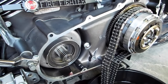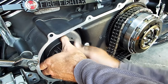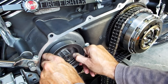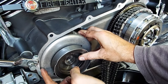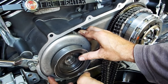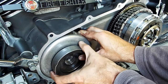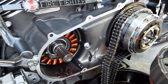Up to about here is how little aluminum had to be taken away for this to fit out through here. The magnets are going to pull and work against you of course, but if you take your time — there it goes. Through trial and error, when I got it this far off the bike and it would bind, I could see in the aluminum where the metal was coming up against it. I'd know I needed to grind down that spot just a little more, then try again. Eventually I got it so it just comes right out like that — no issues, no weird stress marks.